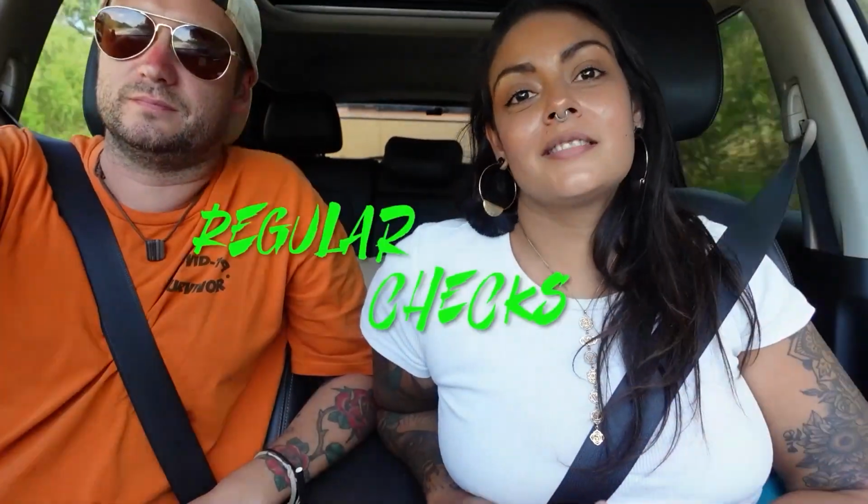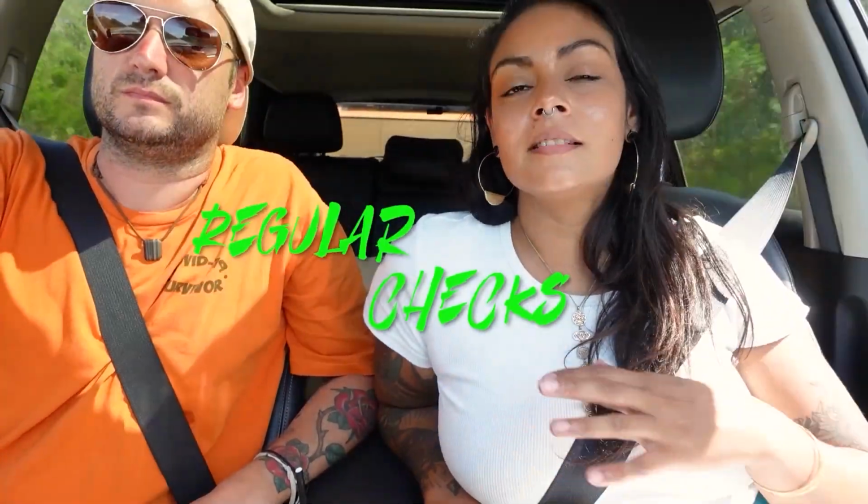So, lesson number two of the Gibb: regular checks. You need to get out and stop after, you know, an hour on those corrugated roads. Things can be rattled loose. You want to be checking that everything is where it's supposed to be, making sure things are tied down properly, and make sure you check your Anderson plug as well. That's what caught us out. Major setback. You're running a fridge and freezer, you're going to need your battery.